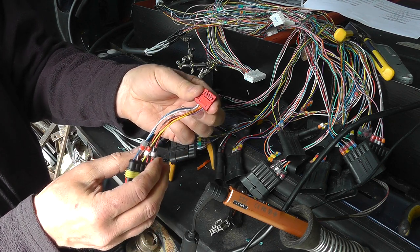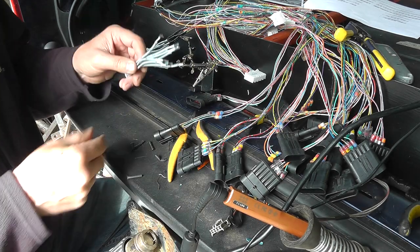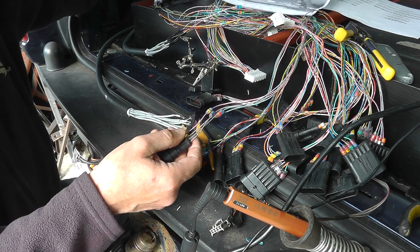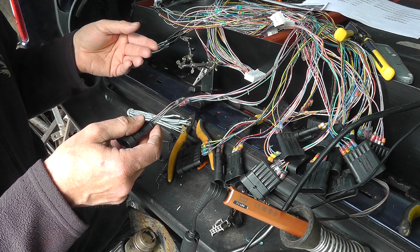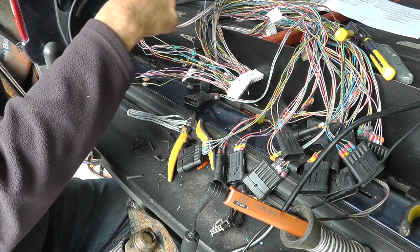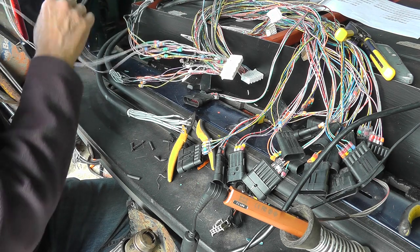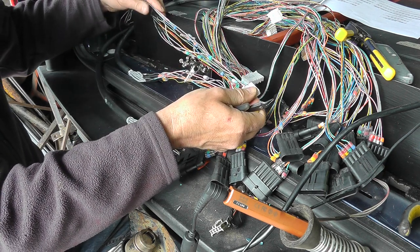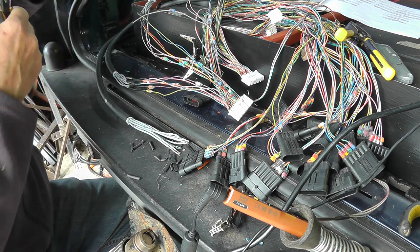we're still able to plug it into the battery module because this end has a plug on it as well. This is the original Volkswagen plug. So now I have these stripped off. I found the module I was looking for, which was, like I said, 61, 62, 63, 64. Right, so I need to cut these wires at a length which is the same as the other ones. So I'm going to slide these down. So all those numbers are now closer to the BMS connector, and I can go ahead and cut these wires. And I can safely cut them because they're not connected to any batteries at the moment.